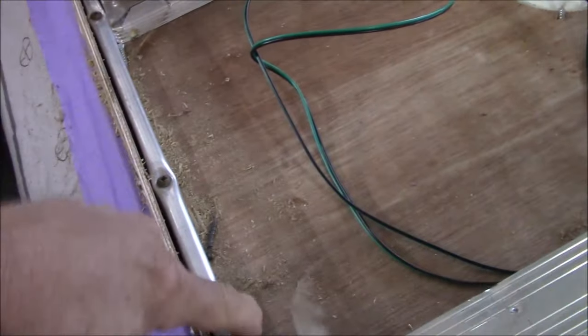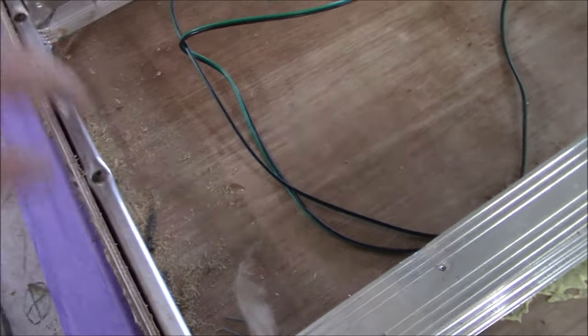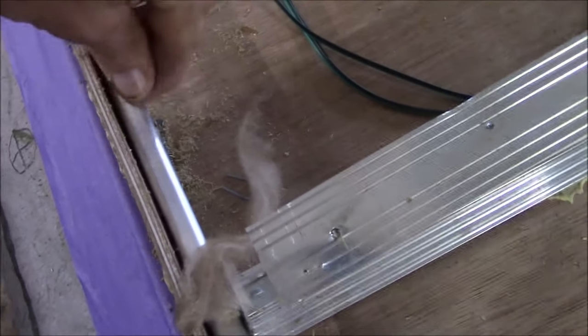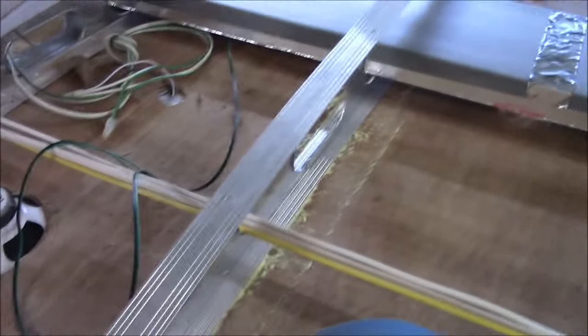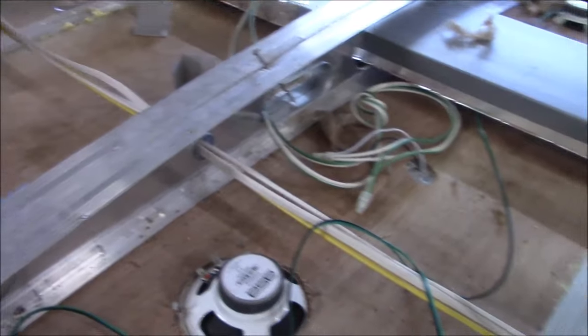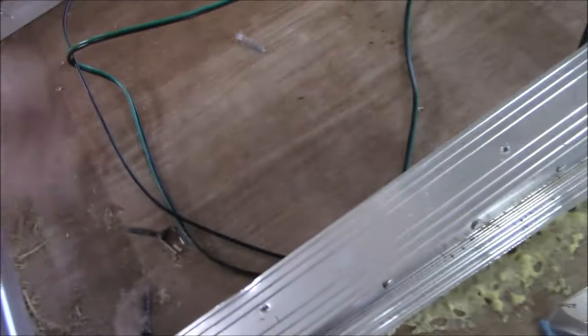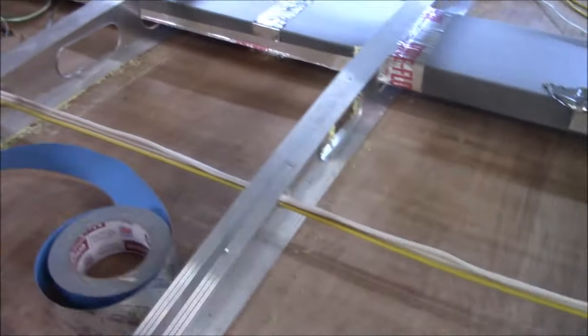There's nothing on this edge right here to hold the plywood, so we're gonna probably have to put little blocks in here just so we can cinch down our plywood to get that to hold proper. This is all they've got, is this little 5/8 piece of aluminum on the edge here for a band. But you know, get it built, get it out, get it sold, they don't care. So let us do some reconstruction here, or some modifications, now that we've taken a gander at it. And that's what we're gonna do, put those in there, and then we'll fix some of these trusses up the best we can, so we can start laying decking.